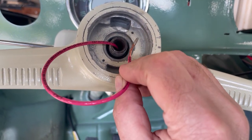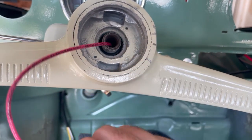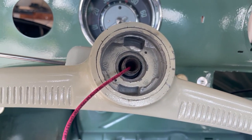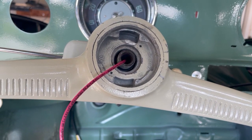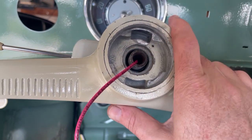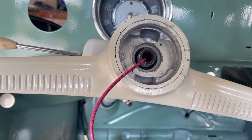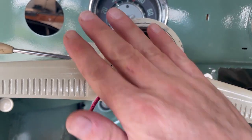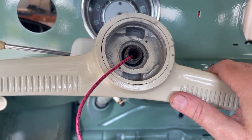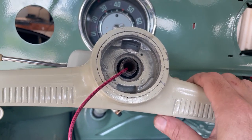As I hit this — pretend my horn is here, and forgive the plane over my house — as I hit that, it continues the ground. The horn is hardwired and we're good to go. Took me forever to figure that out. I hope this helps. Volkswagen played around with this a number of different ways, but I think this is very helpful for all of you that have the earlier ones. Once they got into '62 through '67 this did change quite a bit — my '67 is completely different. But the principles are all the same, and usually with this it's a grounding issue. I hope this has helped — good luck with your bug.